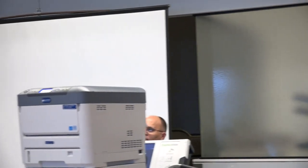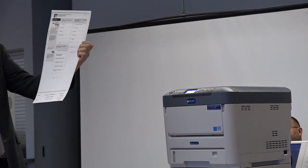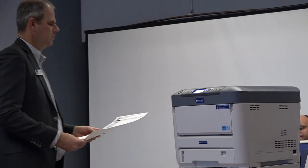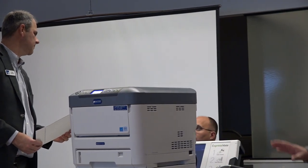Is this a 19-inch ballot right here? Yeah, or 17 with two one-inch stubs. That's the max length of a ballot that will duplex. And again, this has been designed to handle the thicker stock that you use for ballots. It's got heat settings in there to make sure the toner fuses properly so it doesn't flake when it runs through your 850. It's also designed to hold tolerances — it's a graphics printer, so it'll keep aligned.